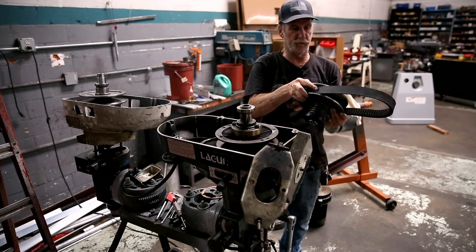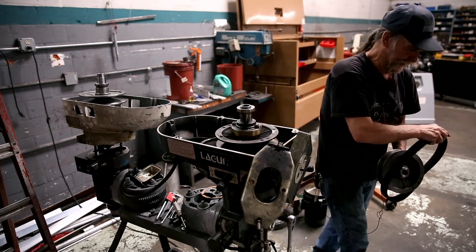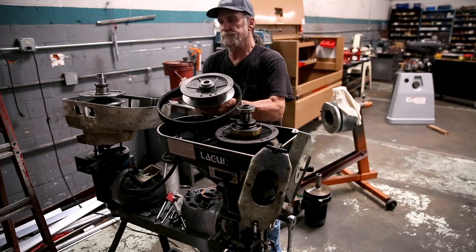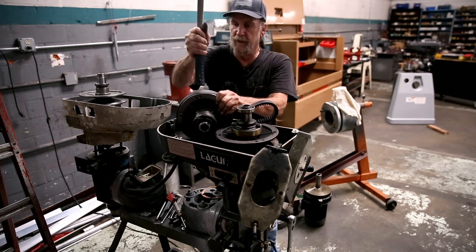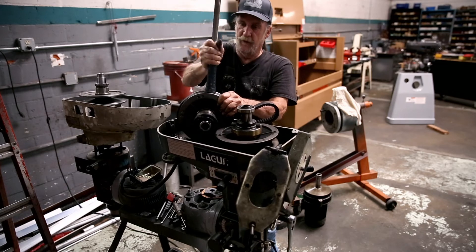This is your rear pulley assembly — this is a nice new one we've got in there. The belt comes apart; just take it out. Take the new belt and basically just get a soft-edged hammer on the tail of it.